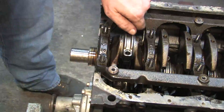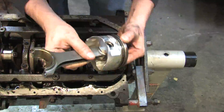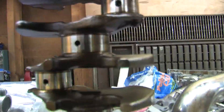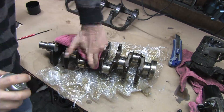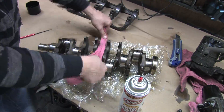Time to look at the mains on the 7-bolt and summarize what blew up. I spun rod bearings, but they didn't do it by themselves. The mains tell an interesting story about what happened, and it's possible to read them. Check the description for other resources. This block did not crankwalk. I think people are too quick to diagnose crankwalk with a 7-bolt short block failure, and there's really a lot more to it.